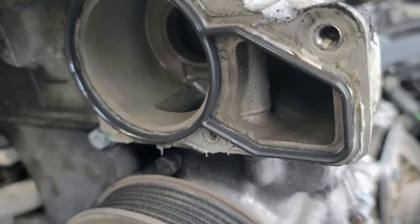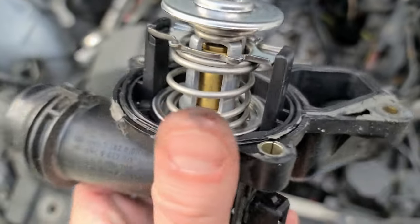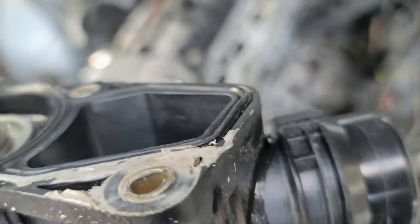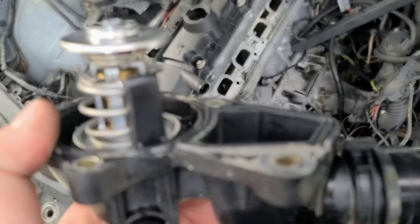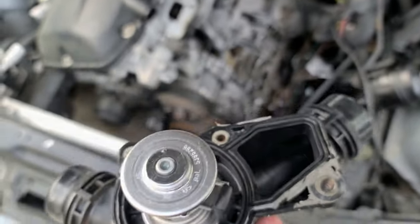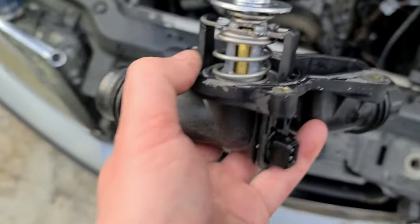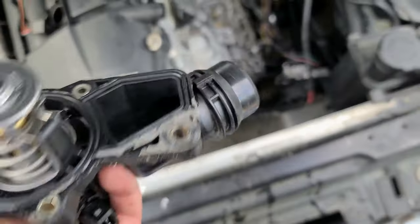What a surprise. And that's the difference between OEM and aftermarket, is that after all this time the gasket actually is still good. I can almost be certain you can reinstall it actually and it won't leak. Meanwhile, all this Duralast and so on, if you remove it like this, the gasket will be flat. And actually it will leak within about 6 months from your installation.